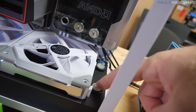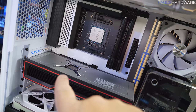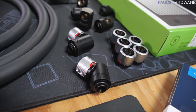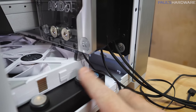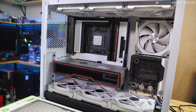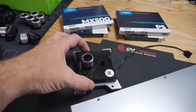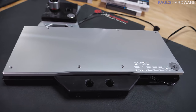Here's how the loop is going to go: starting with the inlet on the radiator, I'll come out and do a short run over to the pump. From that outlet I'll do a nice soft bend up into the GPU, out of the GPU and another soft bend into the CPU, then another soft bend dipping down behind the case where I can use non-matching fittings since they're hidden, routing tubing over to where I need it and then a short run back out using a 90-degree fitting. I still need to install the SSDs, flush the radiators, pull the motherboard for the CPU block backplate, and install the GPU block.